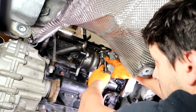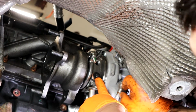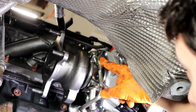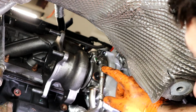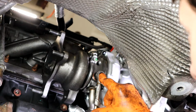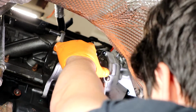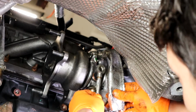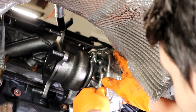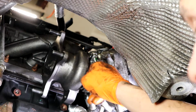If you don't, this pipe, this coolant hose, is going to hit right here. There's this bolt right here. So if you bolt this on without a thicker washer underneath, this hose hits this pipe or this bolt, and after you tighten it down, it either cracks or you have a leak. Or you can plug the top hole and leave this one hanging down a little bit and put the plug up here. The only downside with that is you can't lock these hoses together, because they're meant to be together. I don't know why, but you could do that and it's kind of pushed up and jammed a little bit. Like I said, you either double stack your washers.